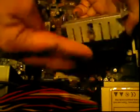This edge for this one goes near the socket lever. So you can look down on this underneath the socket. There's a bunch more of the board. When you go to put it back on, you're going to gently let it fall into place. You're not going to push and do any of that because you're going to bend those little pins. Then to lock it down, gently push down, pull out just a tiny bit, and let it pop over. That's to put your processor back on. Then to put this back on, remember this edge was over here. It's something you want to remember.